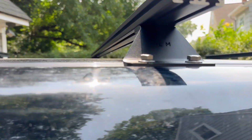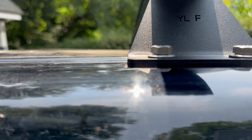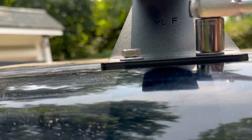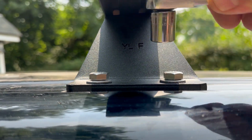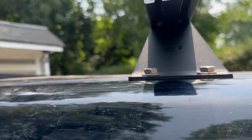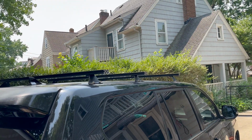Let me show you the other side. This side is torqued down to 22. You can see there's a lot more dome to the washers. And I think it's because the bolts are getting tight with the old Loctite and not necessarily getting tight because of 22 foot-pounds. See, I can turn this easily by hand. I'm just gonna tighten these down a little bit. I'm gonna try to keep the feet level as they sink in with the car. And just go with what the factory Sherpa is saying, which is don't over tighten. And I think with this small quarter inch ratchet, they won't get that tight. They won't over tighten them. Anyway, progress is going, looks good.